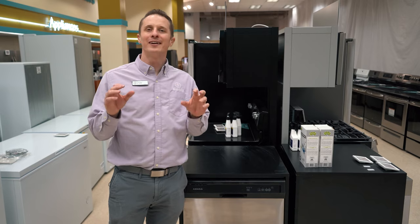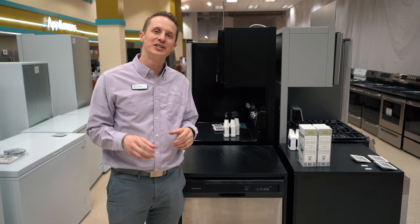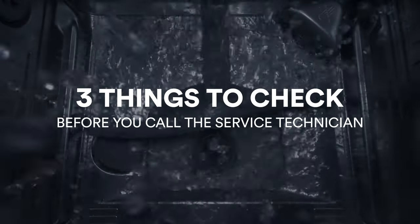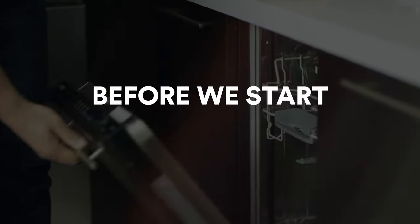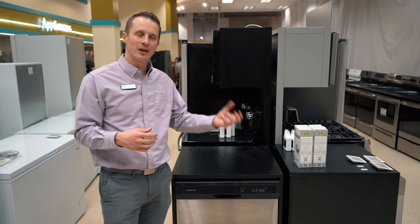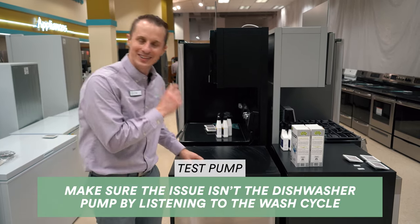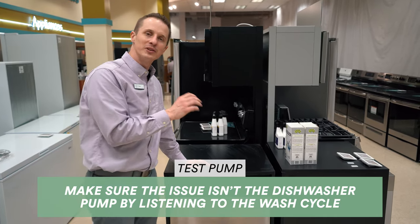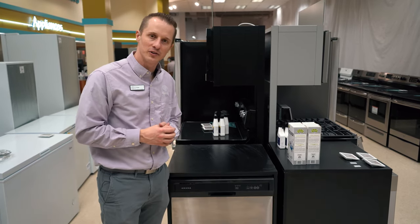Do I have to call a service technician? What we're here today to tell you is: make sure before you call that service technician you check these three things first, and it might save you a few bucks. Many times when your dishwasher is not draining there's some type of blockage inside the draining system, but you first want to make sure that pump is working. If the pump is not working, then you may have to call that service technician. The best way to know if your pump is working is to run that cycle — if you can listen and hear the pump trying to pump the water out, you know it's not the pump and it's probably something else inside the drainage system causing the dishwasher not to drain.